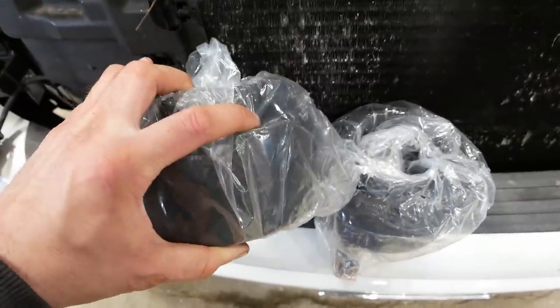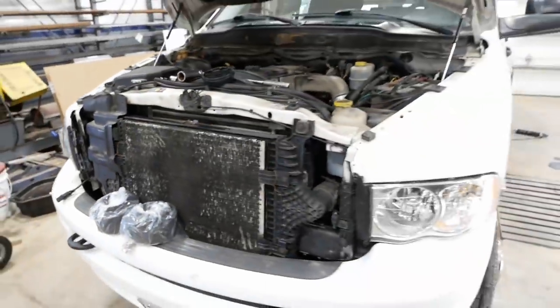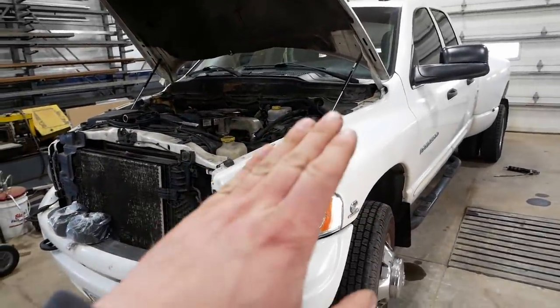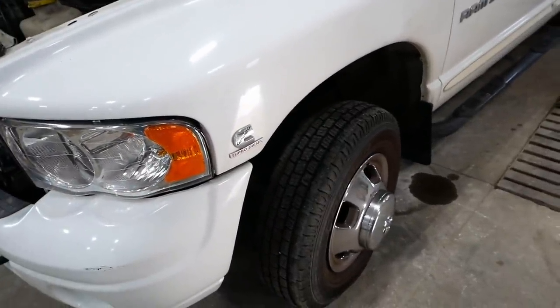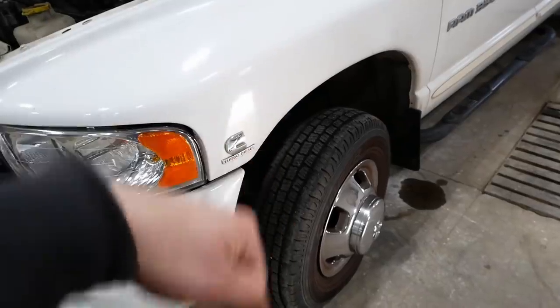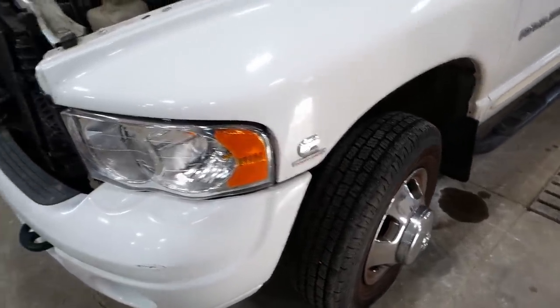That's a 3-inch spacer. This thing will look ridiculous. Jacked up 3 inches in the front. Can you imagine? You put a trailer on it, it's gonna be squatted pretty good. Plus, I don't even know if we can do it with the factory shocks. I think you gotta have longer travel shocks, and then plus your caster angle is gonna be all wrong. And these Dodges are hard enough on ball joints as it is.